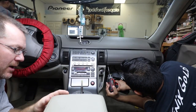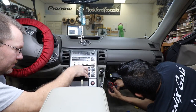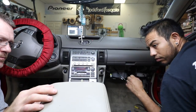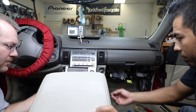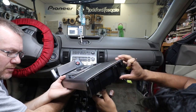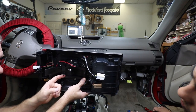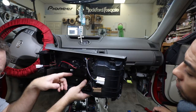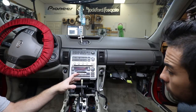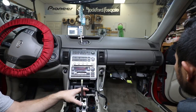Go ahead and put the gear shifter back into drive, then pull up on the armrest. It kind of pulls back and up a little bit — unplug the harnesses and remove it. In case I forget: when you go to reinstall it, see these little nipples that stick down? On the gear shifter there's one in the front and one in the back — those are what you use to line up the center console. Make sure these are going into the appropriate holes.